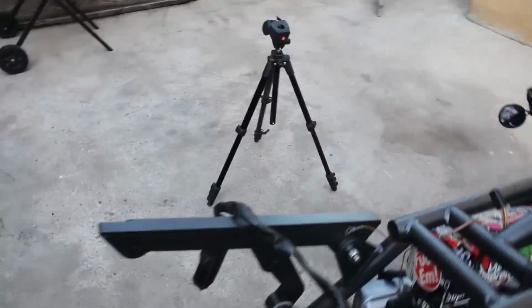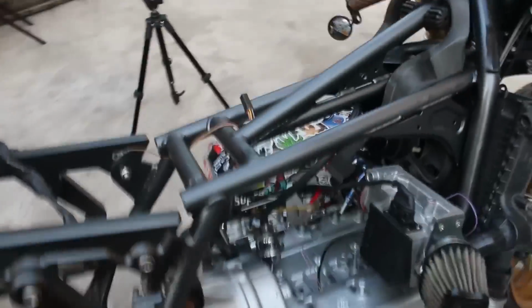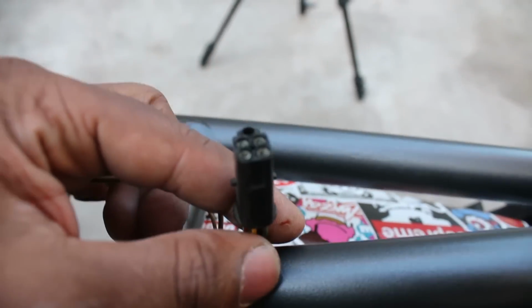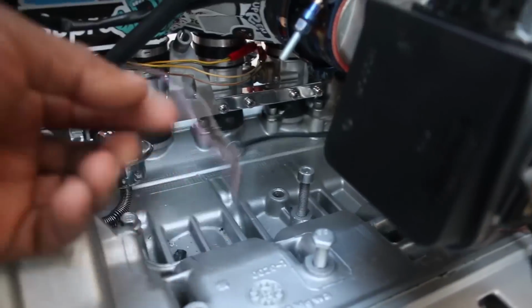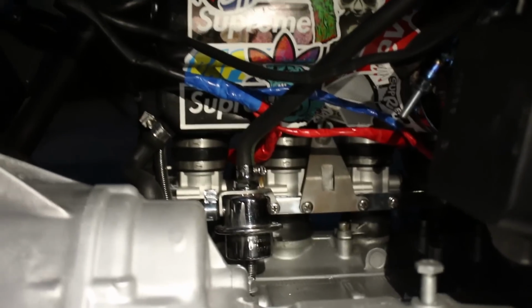So now that I know the injector wires will work in this location, it's time to change the injection harness accordingly. For one, the main connection to the brain is still way too long for this shortened bike, so that's gonna have to be dealt with. The ground wires and the connection to the ignition harness are a good enough length to reach through the bottom of the ground plate right here. The throttle position sensor wire was fine too, as was the airflow sensor wires. The cooling temperature sensor wires were a little long, so that will have to be shortened. I got on those tasks, but the sun was actually beginning to set, so by the time I finished the cooling wires, it was dark and I had to wrap everything up.